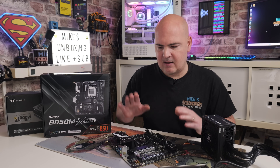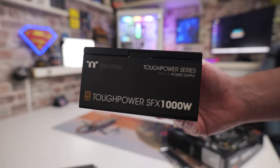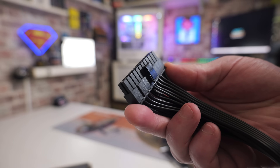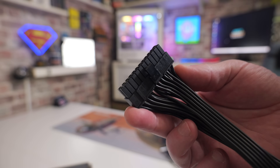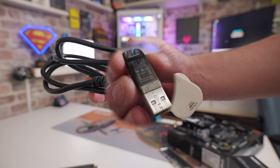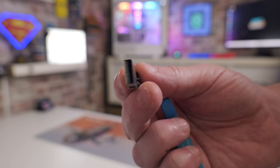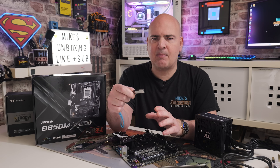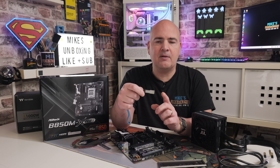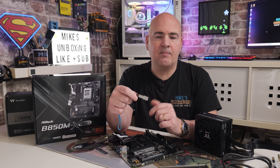There are some things you'll need to do this: the motherboard itself, something to place it on (the box is fine), an ATX or SFX power supply, the 24-pin main power connector — that's the only connection needed for standalone USB flashback — a power lead, and a USB drive. The USB drive needs to be 32 gigabytes or less so you can format it to FAT32. The drive also needs to be MBR rather than GPT. We've done separate videos on how to convert larger drives and on converting GPT to MBR, linked in the description.